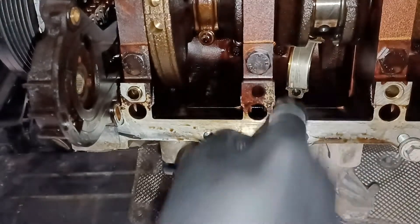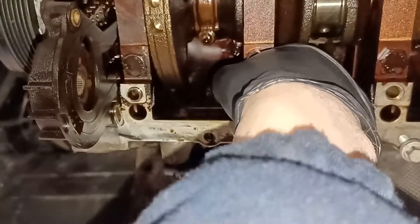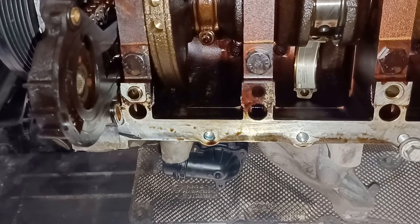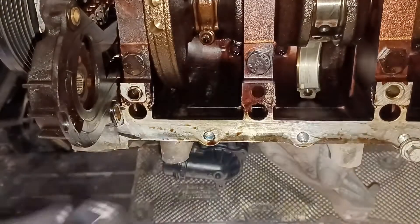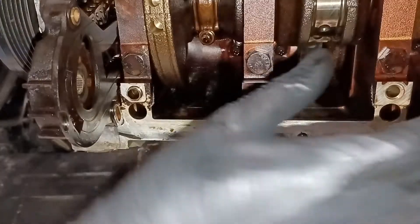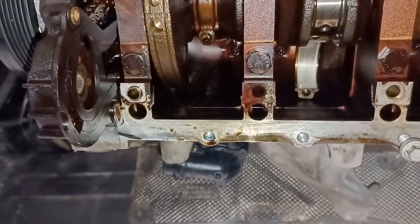The other shell looks in the same sort of state — some slight scratching but certainly not through to the backing material, so it looks okay. The only thing is the con-rod moves quite easily backwards and forwards across the gudgeon pin. I think there's an interference fit in the piston, but it's not supposed to be an interference fit into the bush in the end of the con-rod. It seems okay — there's no sideways twisting, it doesn't flap backwards and forwards, so it's not totally shot. It's quite loose but seems okay. Just hope all the other remaining shells are the same.